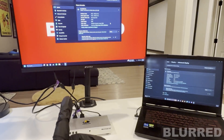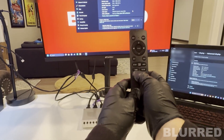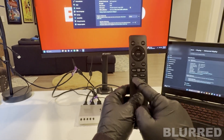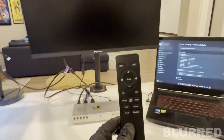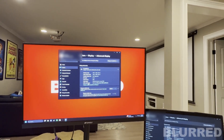After changing the monitor setting, you'll notice you're stuck at 60Hz. To fix this, use the remote — you'll see options for 1K 60, 1K 144, 1K 240, 2K 144, and 4K 60, which all correspond to resolution and refresh rate. If you have a nicer monitor, go for the higher options. Personally I'll do 1K at 240. One display might turn off briefly, but when it comes back the settings will show 240Hz on both displays, ensuring you're playing at maximum refresh rate so the ESP looks very crisp.